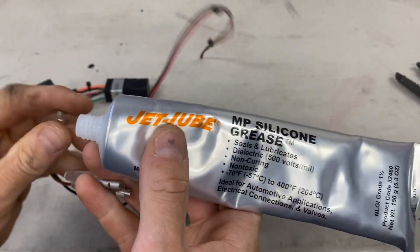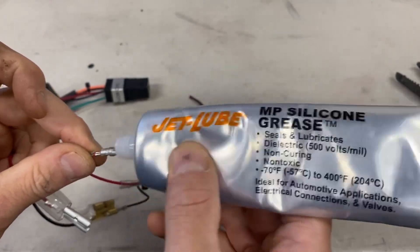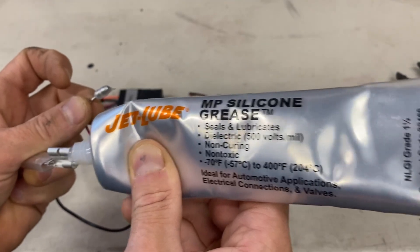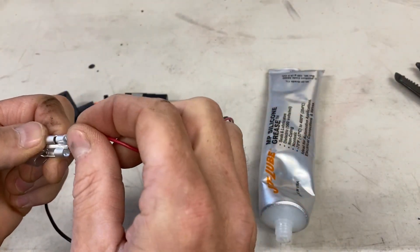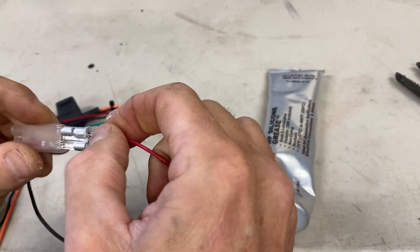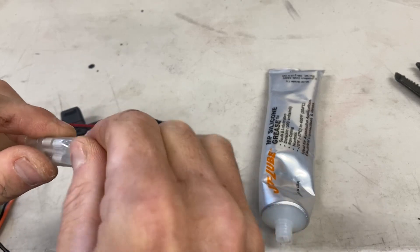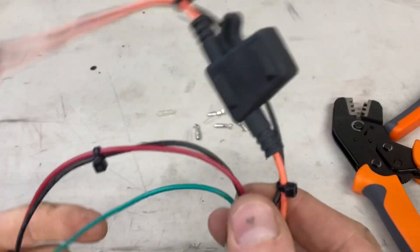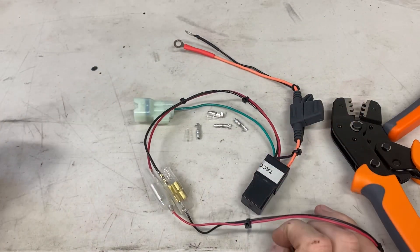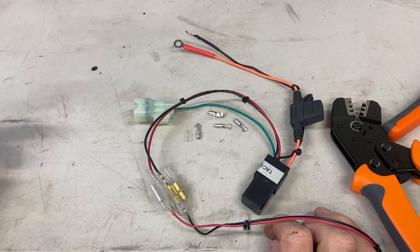You may also want to put some insulating grease on the pins themselves so you don't get any corrosion or oxidation. Take some silicone dielectric grease, get it coated on there, dip the pin in — however you want to apply it to your connectors. Slide them in, now they're grease-coated, and you'll prevent that. Slide the boot back over, just like that. Let us know if you have any questions or comments about this or any other products, or if you need any help with your bike. Thank you for watching — like, subscribe, and go out and get some adventure.